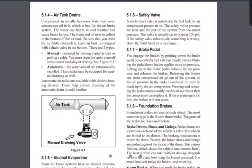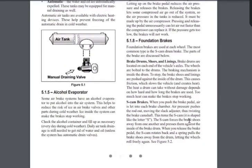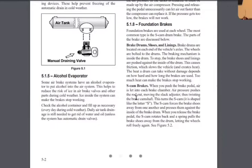That's why the federal government takes the air brake system very seriously — they want to make sure you as a driver understand how it works and what to look for so you can be safe. To clarify: there's no 'water tank' — we're talking about air tanks, but water can build up inside them. That air compressor is a machine, and a machine pumping air can cause condensation and moisture to build up inside your tanks. That moisture can freeze and block your airlines, causing your brakes to lock — leaving you stuck somewhere in winter, unable to move because your brakes are frozen.